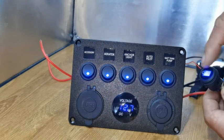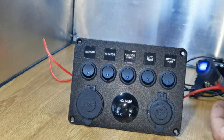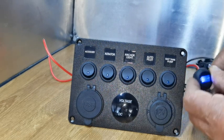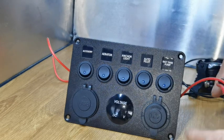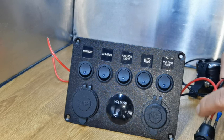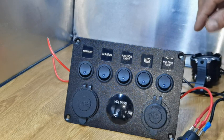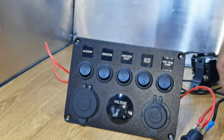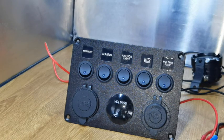I hope that helps somebody because they did ask me to do it. I would use an isolation switch on its own rather than using one of these panel switches — it just makes life a lot easier. All you have to do is drill a hole near it, pop it in, and that's your isolation switch. Battery in, live to the switch, then wire anything you want live and neutral back to your battery. Leave me a comment below or a message and I'll get back to you. Take care, hope you enjoyed that one and we'll see you in the next one.